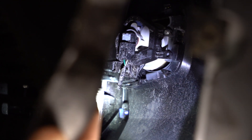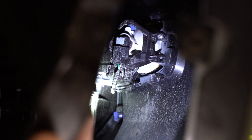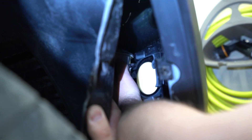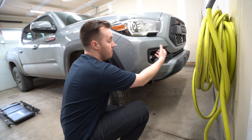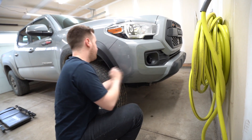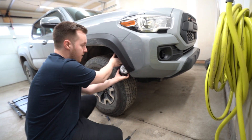You can see the fog light in here — this is what we're going to need to take out. First we're going to unplug it, then undo the screw on the side, and it should just slide right out. Just reach in with the screwdriver — there's a screw on the right side. Carefully unscrew that. Now the whole fog light comes out. You do need to unplug the harness from the back; it might be easier to unplug it before you unscrew it. You can reach in, hold the fog light, carefully unplug it, and now the whole fog light can just squeeze out from the fender.